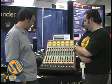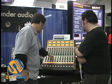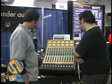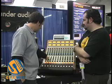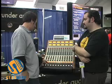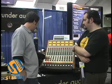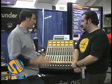There's also mute logic and solo logic — you could globally defeat all your solos or switch from AFL to PFL from the master section. We also have an inline fader. There are four or eight sends, with two different routing modules selectable through your post. What's really nice is that we have a pan defeat, so if you don't want to go through the panning resistor — which is on every console — you can just bypass that. A lot of stuff you don't need to pan, like kick, snare, vocal. Stuff you want hard left and right pan, you could defeat that too just by pressing the left or right bus.